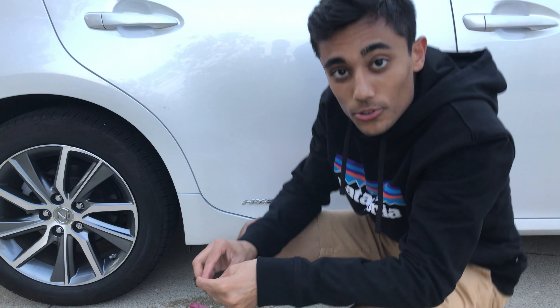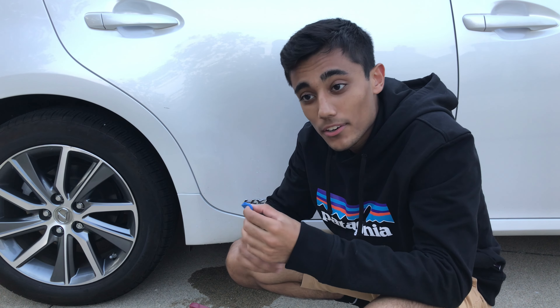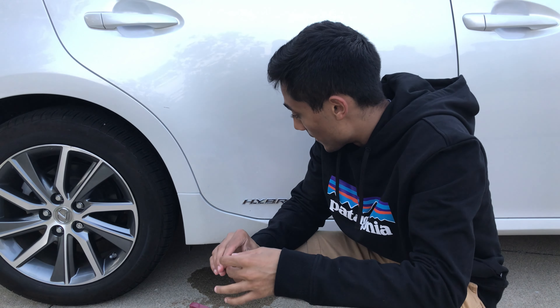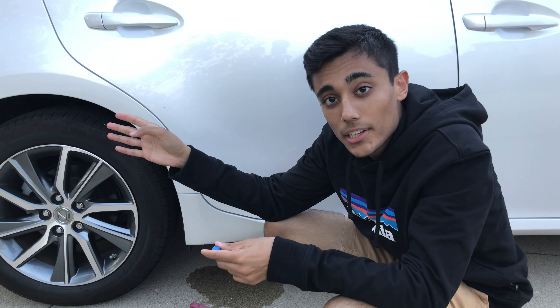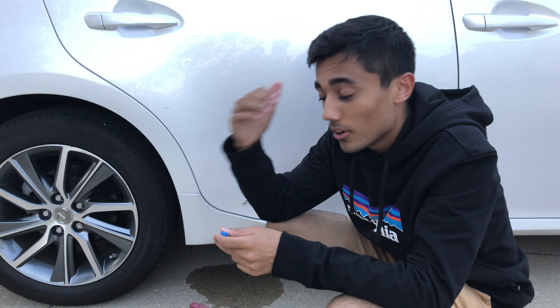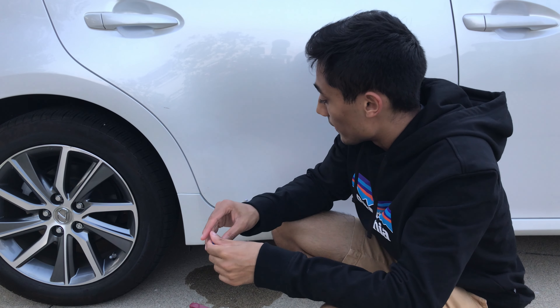Also, if you just saw, you can use clay bar on paint too. A lot of automotive detailers do use it on paint — it's completely safe as long as you keep everything wet. It's really good for removing all kinds of sticky, hard-to-get-off stuff, like tree sap or bugs that exploded at high impact and you just can't get the juices off no matter how hard you scrub with the sponge. Clay bar is perfect for that. And this is also really good for getting in between all these little letterings here, like the hybrid sign or the ES300 badge on the back. Clay bar is just a great detailing tool — it lets you get inside all the little cracks and crevices and clean it out.